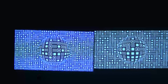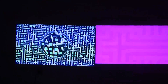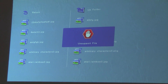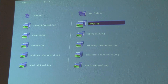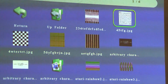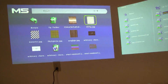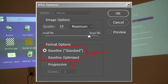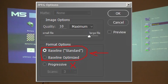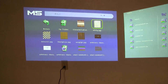Here's what the footage looks like when they're side by side — the M5 is on the left, the M4 is on the right. There really isn't that big of a difference. When I try to go to this picture — unsupported file. I click it and I get nothing. This one actually shows the thumbnail but it still says unsupported file when you click on it. That is because you can only load up JPEGs that are saved with the baseline option selected. When you're in Photoshop you can't save it as a progressive JPEG. Same with PNGs — you have to save PNGs in a certain way as well. They should definitely be able to load any sort of JPEG or PNG file, or GIF, or animated GIF, or whatever.